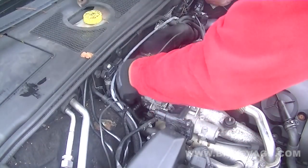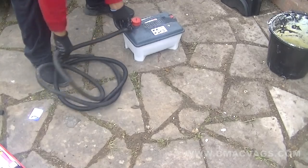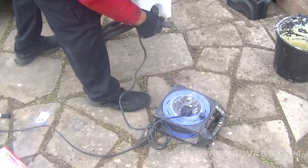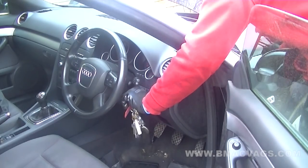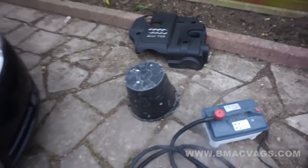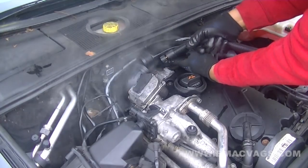Let's gain access to the inlet manifold. We're trying to find a connector as close to the inlet manifold as possible. Fill your steamer up with water and put it together. It takes a little bit of time to steam, but you'll get there. While you're waiting, turn the engine on — you don't have to have it super warm, but it doesn't hurt to have it on and running. Now we're ready to go — steam's ready, H2O's flowing, which is really the best way to clean carbon from your engine.